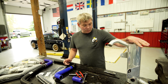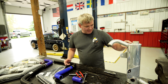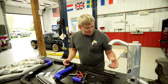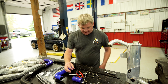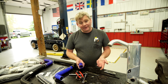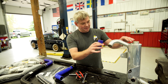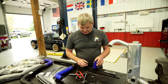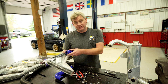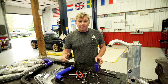First thing I'm going to want to do is get the swirl pot remounted. I popped it off and, as I suspected, it is an aftermarket piece — very similar to the factory piece though. Cleaned it up nicely with some Lume Bright. The only hose I want to change out is this one — it wasn't damaged in any way, it's just blue, and I'm not going to use blue hose. That hose goes from this little elbow piece here into the thermostat housing. So step one is to find some hose that's the right diameter — either 35 or 38 mil — and get it cut to length.